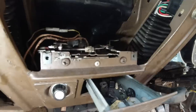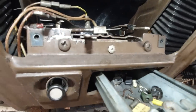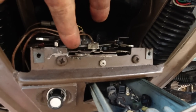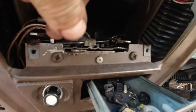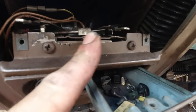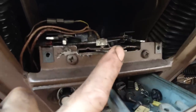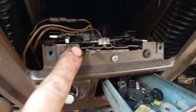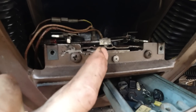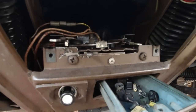And then your little ball bearing I was telling you about, it's just in that lever there. Can you see those little mountains? It's hard for me to show. I can do it here. There's one, there's one, and there's one, and the ball bearing drops into each one, so you get a detent, is the correct word. See that, or hear that detent as it clicks in on the last position there. They're always rubbish on the last position. I've tried to get this the best I can. The arm never quite makes it to snap the last one in. I've noticed that on many of the cars. But that one's about the best you're gonna get.